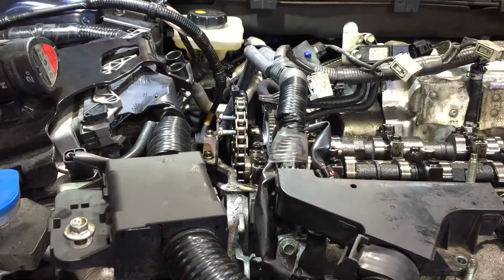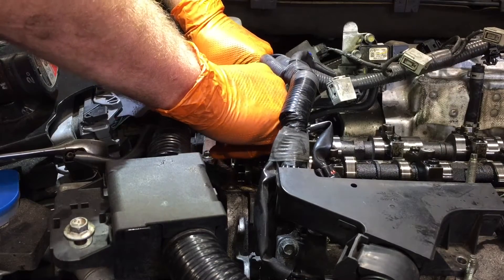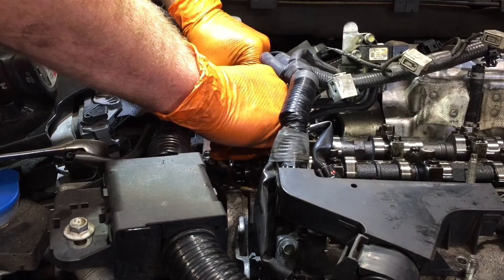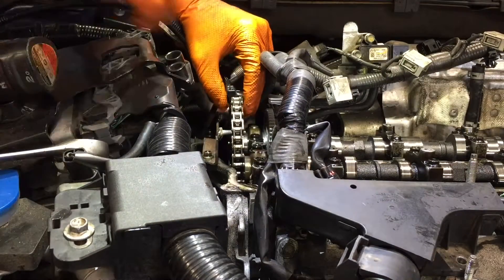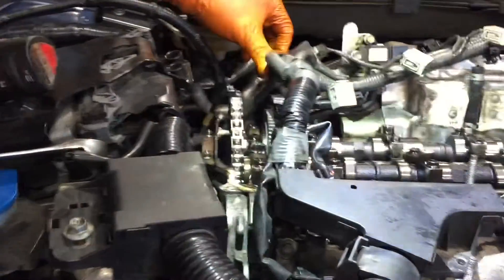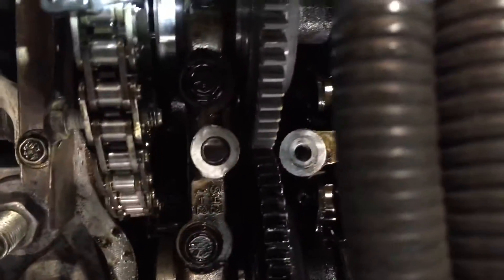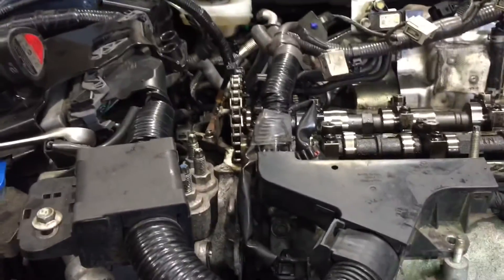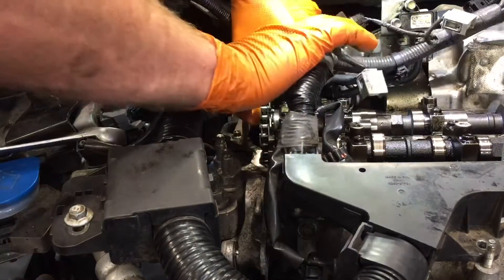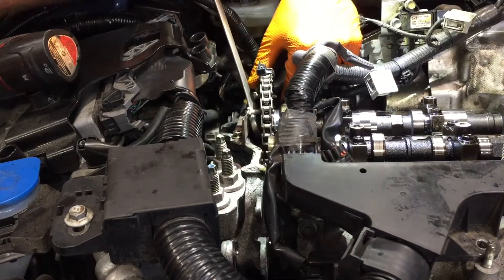That's just to show how this thing has worked. I've put marks as you've probably seen on the camshaft, and my little bolts and this little bracket — the way it worked was, you can see that I can slide the pulley back. I have slid the pulley back enough just to get in, and you can see the bit of space down here where I've pulled it back out. Then putting it back down — now what I've done is to put it back or to turn my camshaft to line up my marks, and I use the spanner just to slip the pulley back.